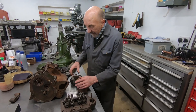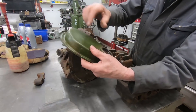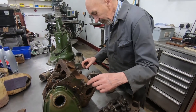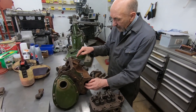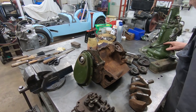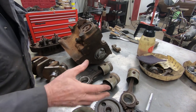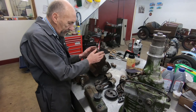The standard A35 Mini fits that. The water pump is the same, which will go in there. The other part is different but it's only a canister with a bolt, so that's going to be no problem. The plate that goes on the back matches up and would go straight onto this because all the holes are there, so it might need a little bit of jiggering, and then we get a normal sump, cut it down and fabricate it.